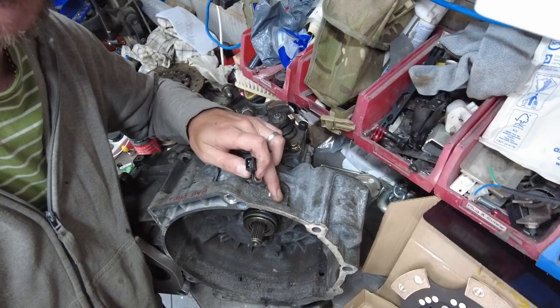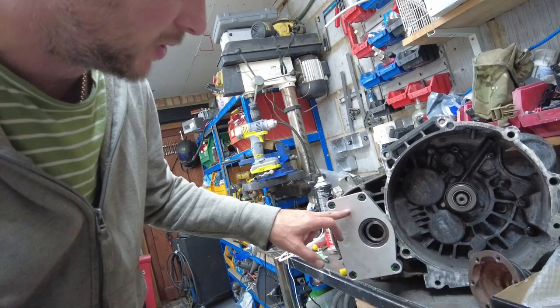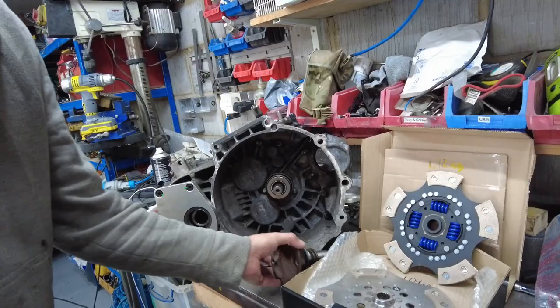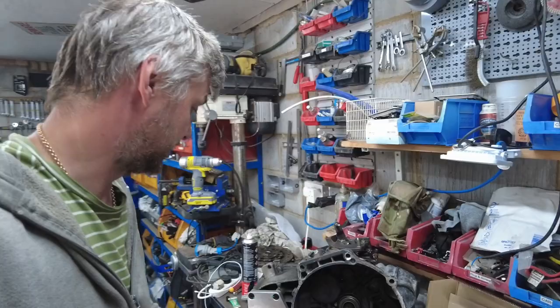And this is the front wheel drive conversion. Effectively, what you do, you basically just block off two oil galleries on the gearbox and you just put a longer drive shaft from a normal front wheel drive gearbox. That's it, easy. I will have to put this later on because otherwise it falls on my plate.